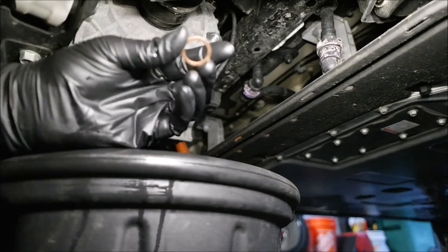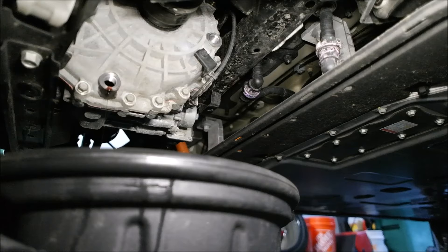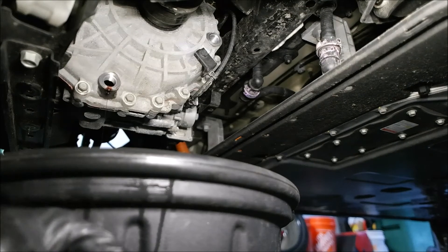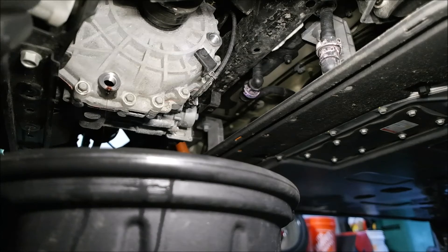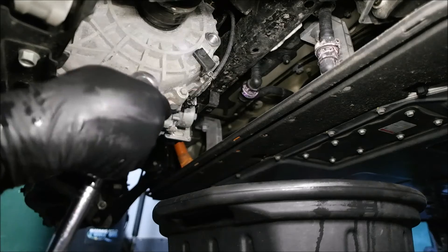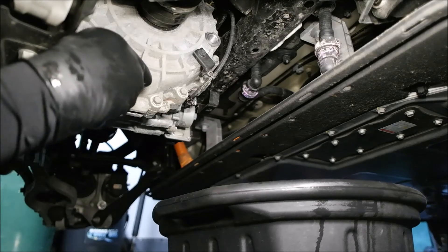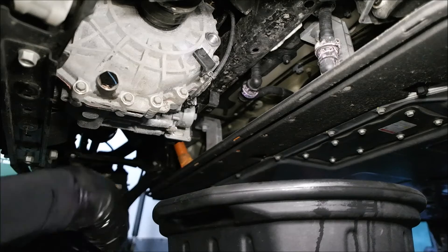So I've got the new copper crush washers — this is 11/16ths, also M18 — that's the size you need, it's a little bigger than normal. I would use either the aluminum style that came with it or copper. In case you're worried about using copper, don't be, because there are other fittings on the drive unit that already use copper crush washers. The torque spec is 49 foot-pounds for both the drain and fill plugs.